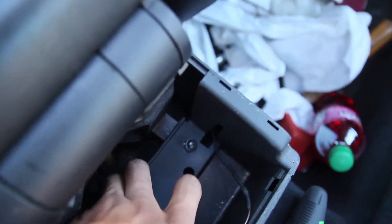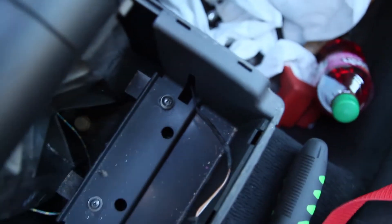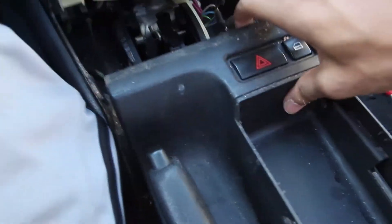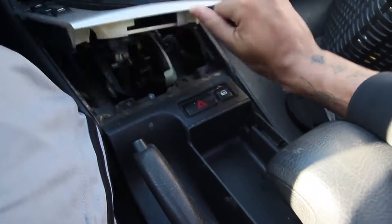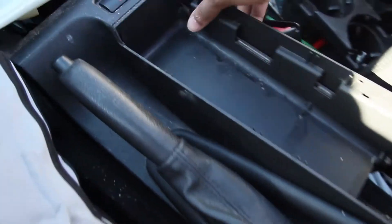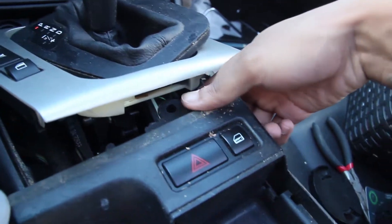This right here — you want to take off the screws. It holds and connects the armrest to the first metal portion of the car itself, so you're going to remove that. Once you get to this point where that is out, you can see it is freely movable. What I do recommend is putting the armrest up, to have more room to work with when you want to move this up. Move the armrest up — you can actually lift it much higher. With the armrest down, you're very limited in the motion. So move the armrest up, pop this out. With the armrest up and out of the way, you want to lift this portion from here — you can do it one-handed. Lift this and get it around here, fingers all the way in, and you just want to pop it up. And then you have it out.